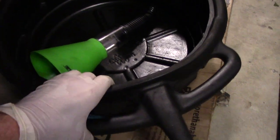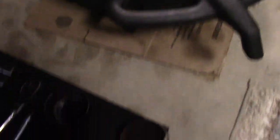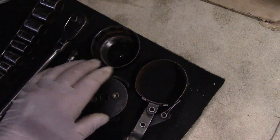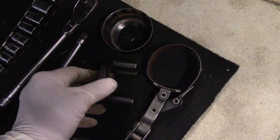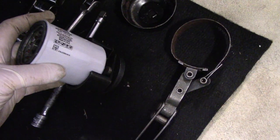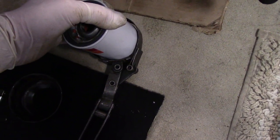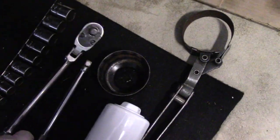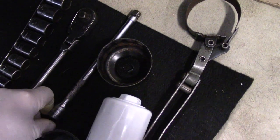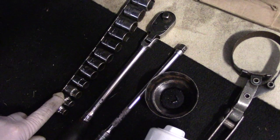We're going to need a bucket to drain our oil into, and a funnel to put the oil back into the vehicle so we don't spill it. We'll need a couple of different tools to take off the old oil filter — personal preference which one you use. I particularly like this one: it grips into the filter on the side. If you don't have that kind, you can use a cap that goes over the top of the filter, or the old style band-style filter wrench. We'll also need an extension to get up there since the filter is recessed underneath the car, a fairly long ratchet, and a good set of metric sockets to take the oil drain plug out.